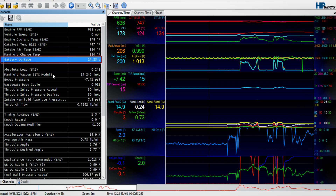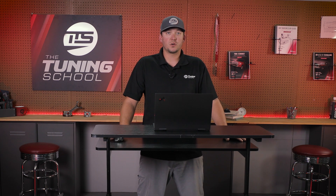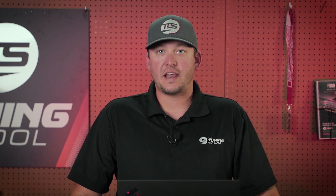We want to make sure it's sitting at a pretty decent level so we know we're going to get the power and voltage to all those devices when we need it. In this case, it's sitting here idling at about 14.2 volts — more than enough, this is a healthy system. Some vehicles might be in the mid-12s or 13s, which is probably okay, but when you start seeing things dip into the 11s and 10s, you probably have a charging system issue, maybe a bad ground, a weak alternator, or a battery problem you'll want to address.